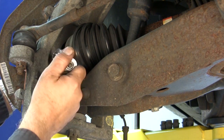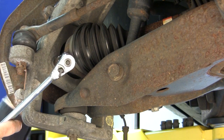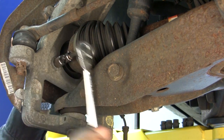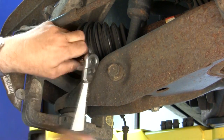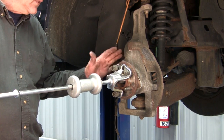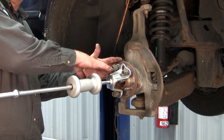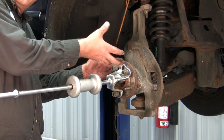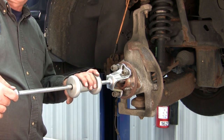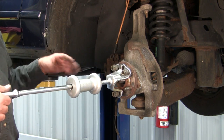I'm using a 3/8 inch 15 millimeter socket with a swivel. If you need the extra clearance, you can take and push the CV joint back to give yourself some more clearance. And then it's just a matter of removing all three of the bolts. Some hubs can be very difficult to remove. One of the ways we can do this is with a slide hammer. A couple other ways would be to hit the triangular part of the bearing with a hammer and actually turn the bearing hub in the knuckle. The slide hammer makes it much easier — a couple slides and usually you can get it out.